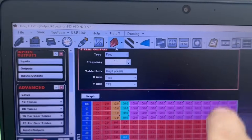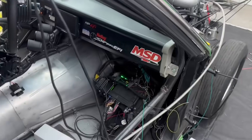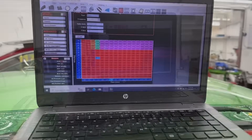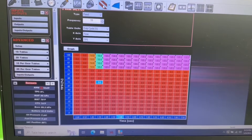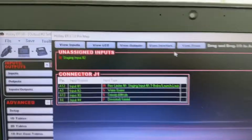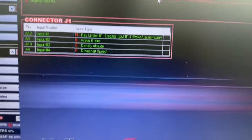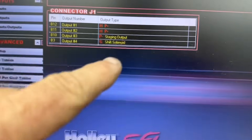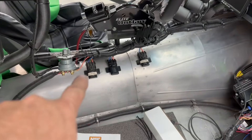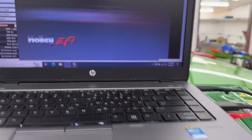So that adds a lot, but when you read the fine print it does add those inputs and outputs, but they're not usable from what we can tell with your normal ICF up here — unless somebody knows a way to configure the software to use the CAN bus. From what we can tell that is not possible. When we open the nitrous ICF or the boost ICF and open the pin map, it would put our nitrous stuff up there, but all his inputs are utilized and the outputs are the problem — he's got three solenoids down there.